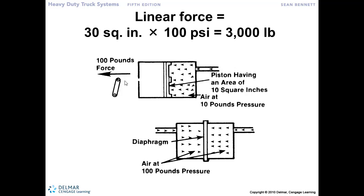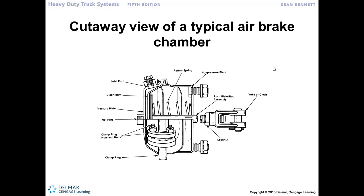The pressure over the surface area increases that force. So I cannot easily create 3,000 pounds of force, but I can open up the brake valve and allow that pressure to flow through to give me an effective 3,000 pounds of braking action.